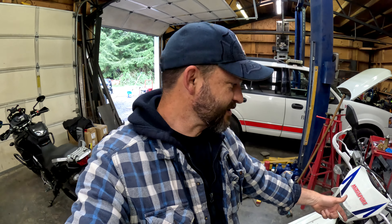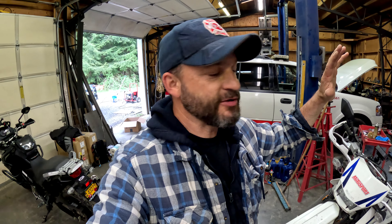Mission success. After I started the bike up, it jumped right up there to 13.9, 14 volts, and it stayed there. So we've definitely identified and solved our problem. I feel pretty good about that repair. That connector lasted 12, 13 years the way it was, and the repair I did should probably last at least that long.